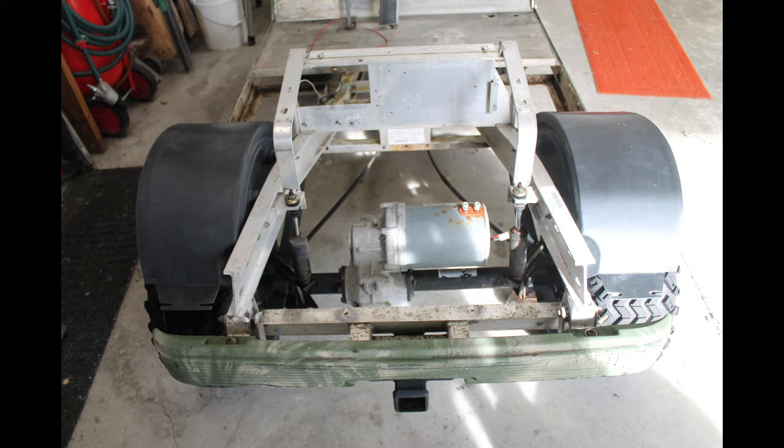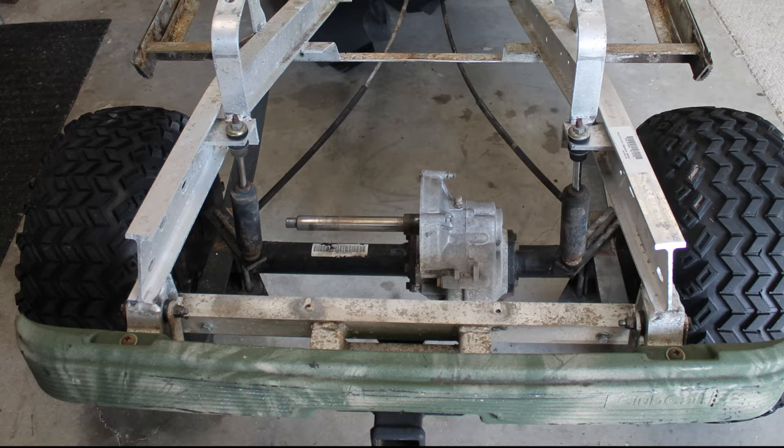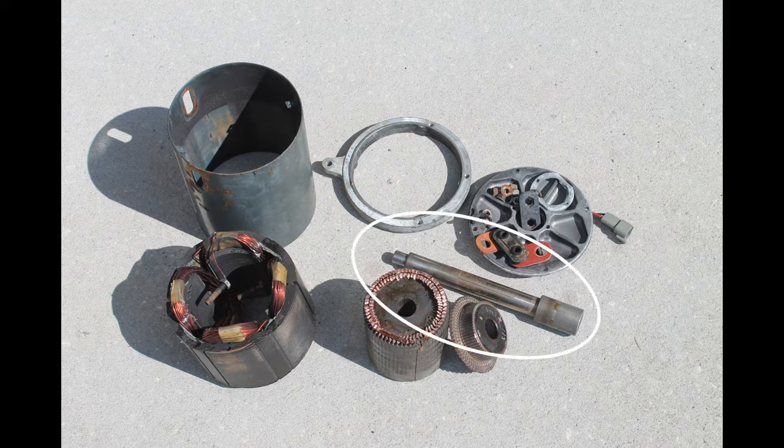Here is the drive motor in its original position. I removed the brakes and axle shafts and then flipped the rear end 180 degrees and reinstalled the axle shafts and brakes. This will facilitate the installation of the transmission. I also pressed out the shaft from the drive motor for later installation of the 12 tooth sprocket.